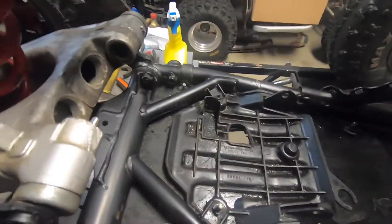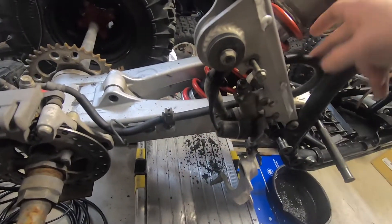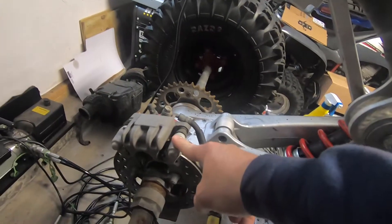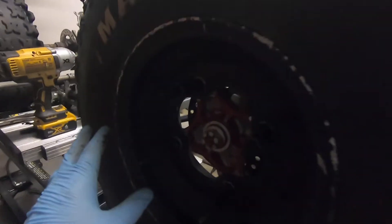I will clean it one more time before I put the engine back in, but at this point I'm going to take the mounts for the brake line off the swingarm, remove the caliper from the swingarm, take the two tires off, and take the swingarm off the bike so we can remove those needle bearings. These lug nuts here take a special socket — the hex isn't really a hex, it's weird. Instead of two parallel surfaces on either side, it's parallel here and pointed here, so it clearly takes a special socket which I don't have.